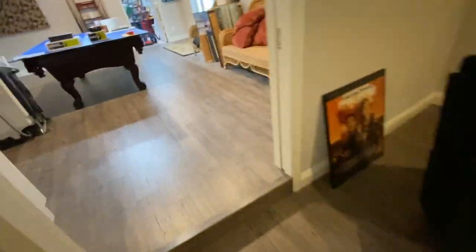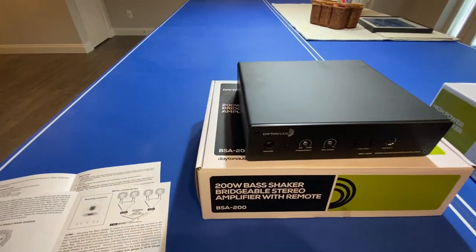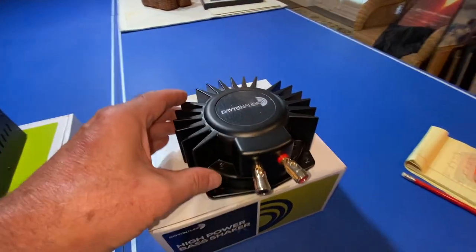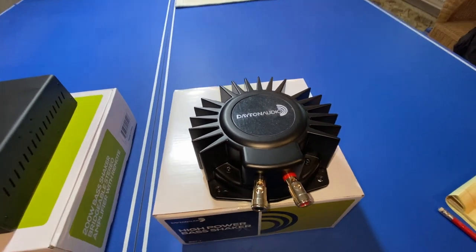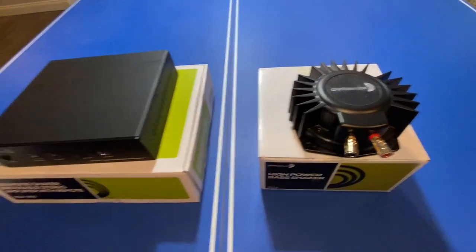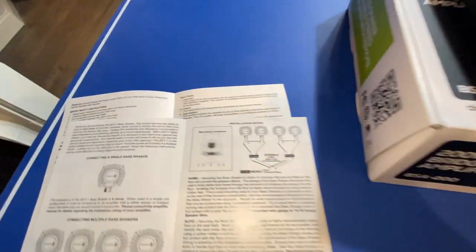What we're gonna do is mount a couple of boards on the bottom of this couch and put the transducers here. I have four of them, so I'm gonna do one, two, three, four transducers. The equipment I have is these bass shakers by Dayton Audio — this is the actual transducer. I have four of these, they need to get bolted on. Those boards I'm gonna install, so it's a very solid mount, and it came with this amplifier, and I'm gonna wire them just like the book says.